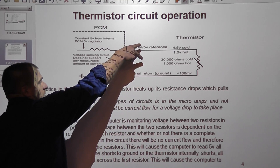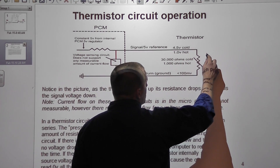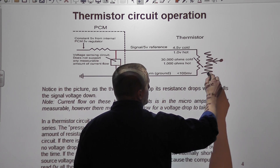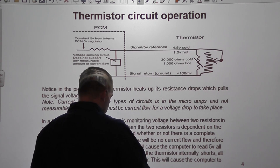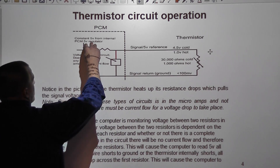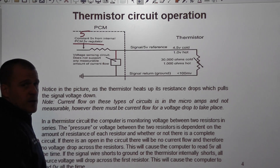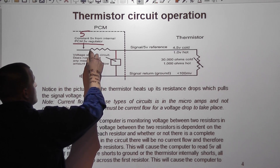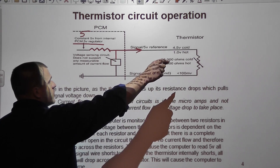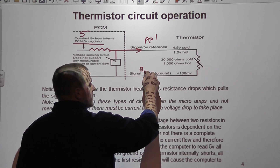What we have is the two wires going to our tank unit. On our design, there is a fixed resistor and a wiper that moves across it to the signal — just a little different as far as the resistance changes go, but the circuit is identical. There is a 5-volt constant from an internal regulator, and that 5 volts is going through a fixed resistor and being sent out to our sending unit via the purple wire, with the orange and black as our return.